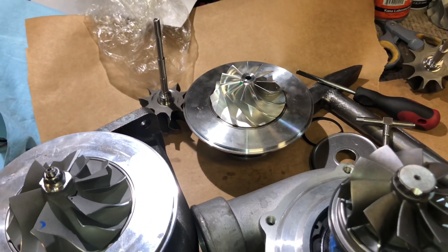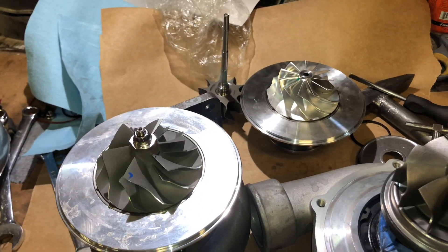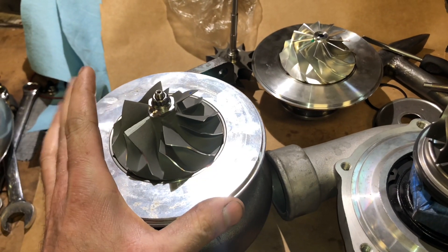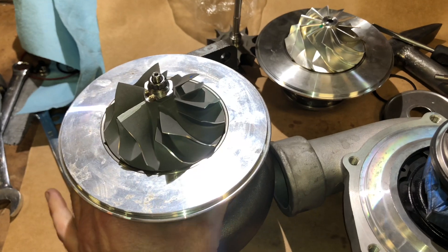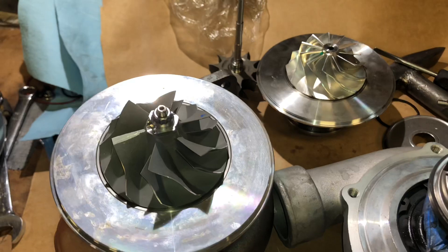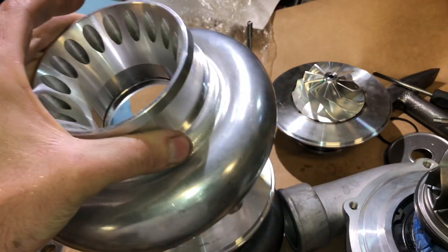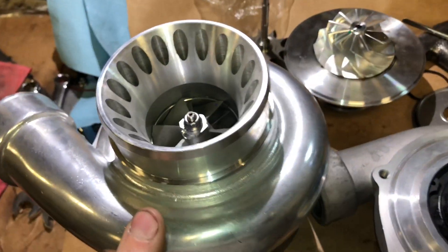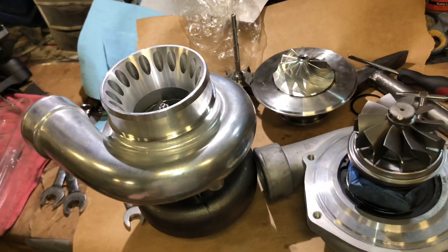It could be more reliable if that version is not reliable, but you can actually get repair parts for this and it's proven to last. This right here is a GT35R cartridge that I built, so this will swap directly into the exhaust housing. This is option number one, and the compressor housing swaps directly onto the center cartridge — everything's a direct fit. That's the easiest way.